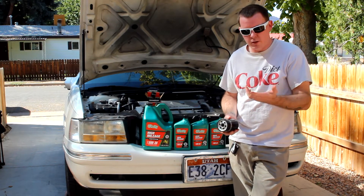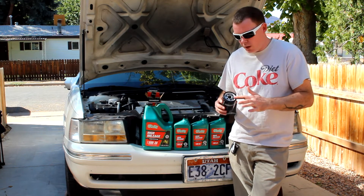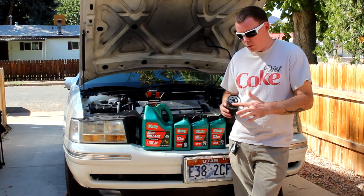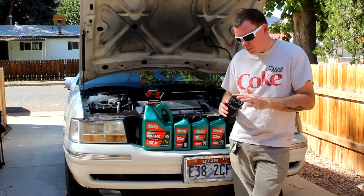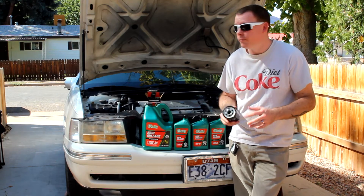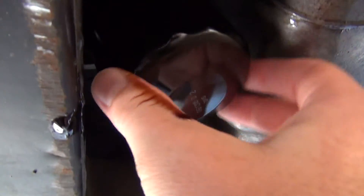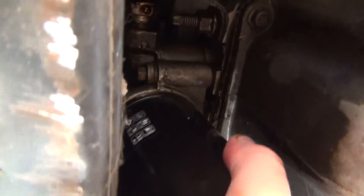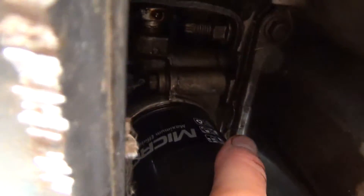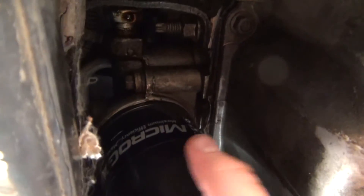Before you install the new filter, you want to get some of the old oil or even some of the new oil and put it on this rim right here, just so it has a good seal and won't dry out as easily. The rubber seal that goes around this — just put some used or new oil on there, put it around there, and it should have a good tight seal. Just stick that on there and start screwing it on. This is definitely the size that's supposed to be on here because it sticks down a lot farther and is a lot easier to grip. This doesn't need to be really tight — just hand-tight really.